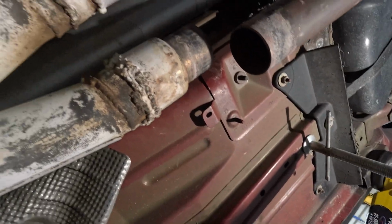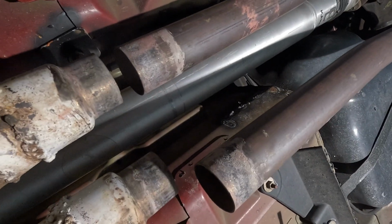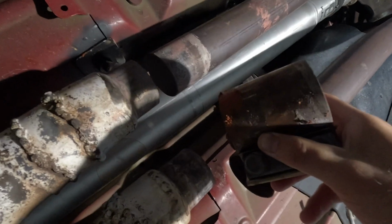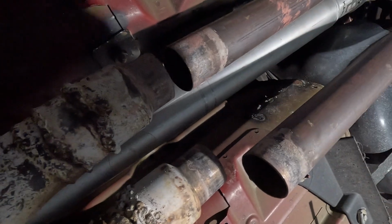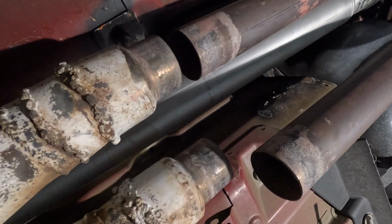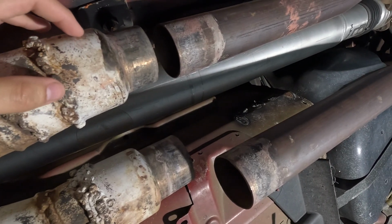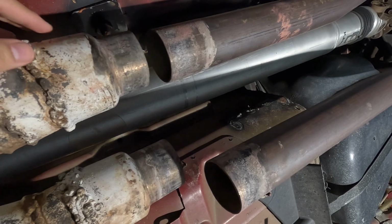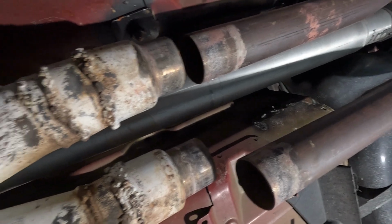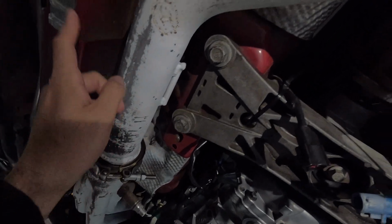Anyway, for here, what happened on one of the practice laps was these band clamps. They do work fine for the most part. However, I think Road America was such a long course, and it was July essentially. Basically when I get off track, they would loosen up. So it's time to put V-bands on them and not have to worry about that whatsoever. As you can see, I do have V-bands over here on the exhaust.